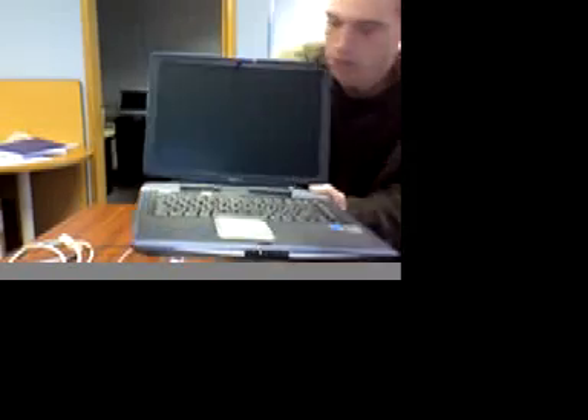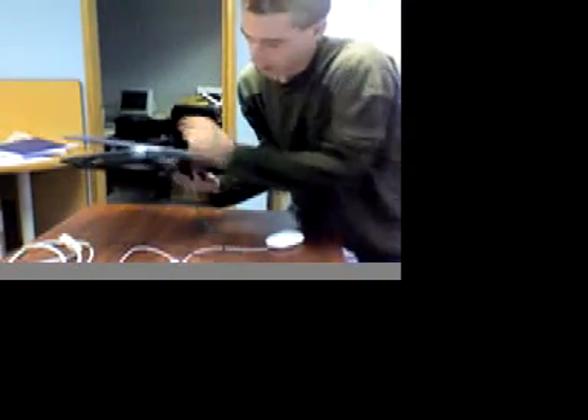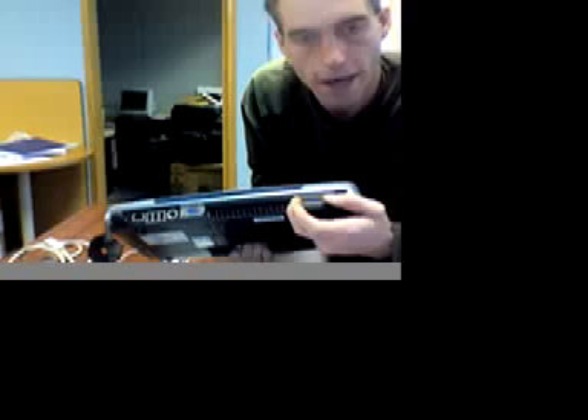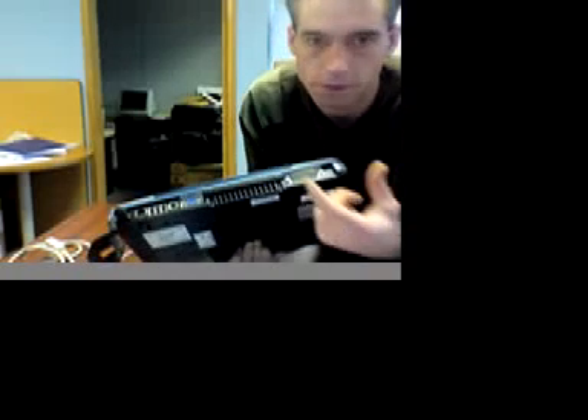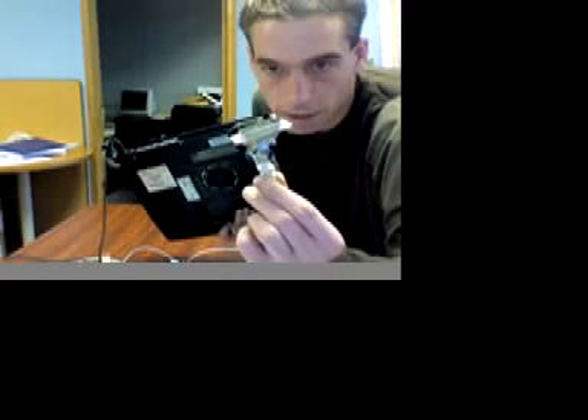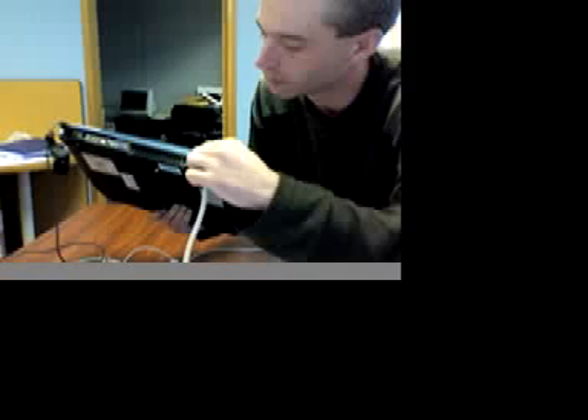There is no way around this in most cases with most laptops. The Toshiba model and many others have something called a dongle that will bypass this BIOS password. The dongle typically plugs into the printer port on the back of the laptop, and it jumpers from one connection to another in a specific sequence unique to the dongle itself. When you order this dongle it allows you to bypass the BIOS password, but they do a security check to confirm you're the owner before selling it. What we're going to do today is create our own dongle by rewiring a printer cable from scratch, following instructions found on the internet.